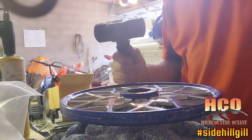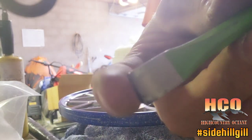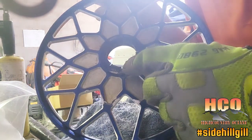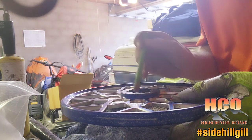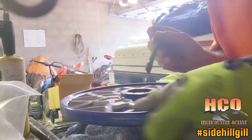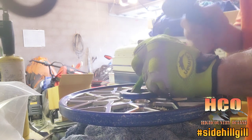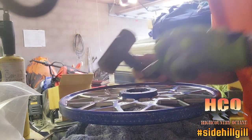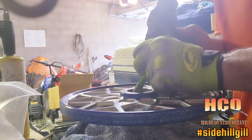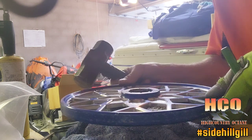Step two of the process: bigger hammer and a cold chisel. The problem I've got is I'm breaking off the corners of the cold chisel - I've rounded them out. Like I said, once I opened up these little holes, I can't really catch enough lip. I went to a heavier hammer and the cold chisel and that was a fail.